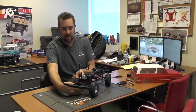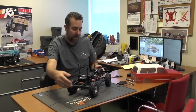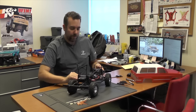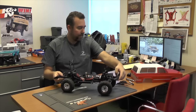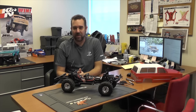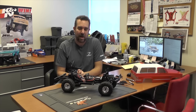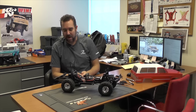We haven't affected our clearance — we still have the pumpkin on the differential here which has the same amount of clearance. Next thing we're going to do is lower the body, for a couple of reasons. Personally I like the way the lowered body looks a little bit — it makes the bumpers fit a little bit tighter to the body, and again it gives us just a little more lower center of gravity as well.